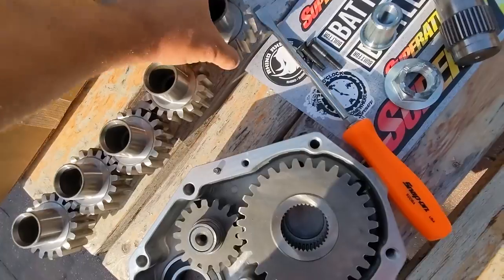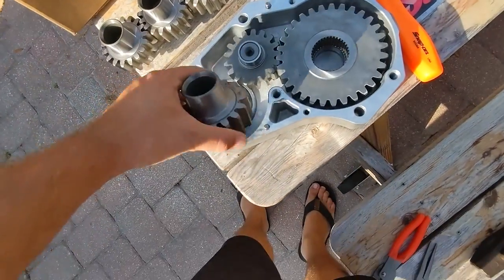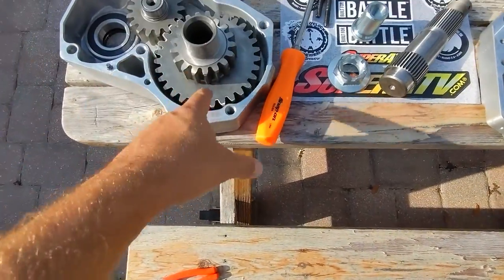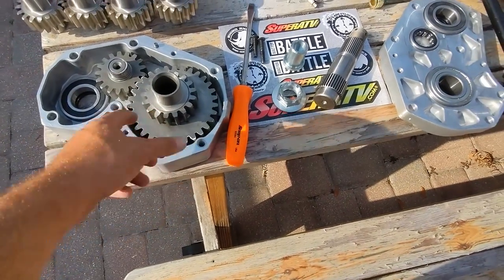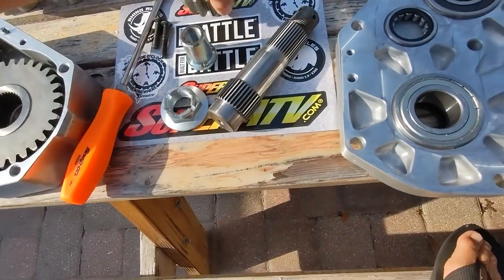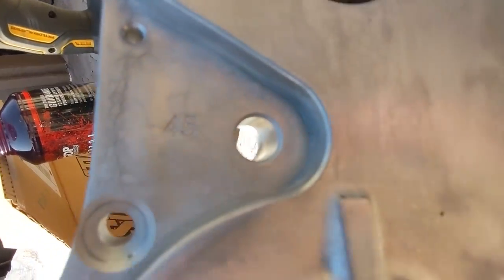The input gear is the top drive gear — this is what your axle plugs into. Your axle turns this gear, which turns the idler gear, which turns the big gear. These are 45% reduction boxes, so the ratio is determined by the teeth count of the input gear versus the big gear. The idler gear doesn't factor into the ratio. If you divide input teeth by output teeth, you get your true ratio — I think it's about 1.82, so roughly an 82% reduction. The box is actually stamped '45' on the side for 45%.